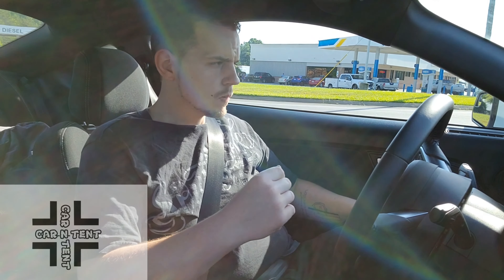What I like to do with an NA car — you should let it idle for a couple of minutes, two or three minutes. Put on your seatbelt, check your phone, do whatever you need to do, get situated in the car, and then take off. And be easy until your oil temperature gets up.